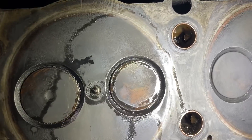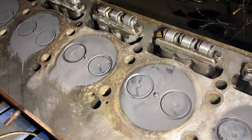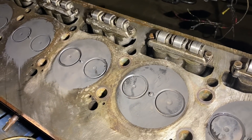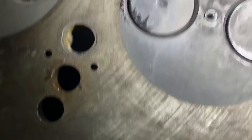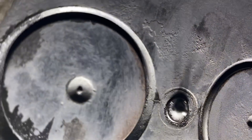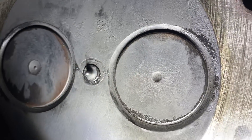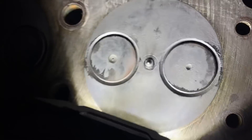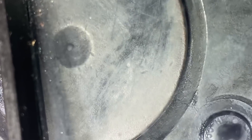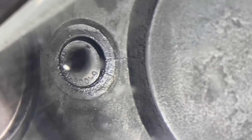And that's where these two valve heads always crack. I talked to Stan and gave him the idea of using this other head — the one that came off the 4103 that's outside. He said we could go ahead and use that head on this engine on this 4103 to get it going; it's more of a priority. I was just doing a little inspection on this one — same story, different head. Sure looks like a crack to me.